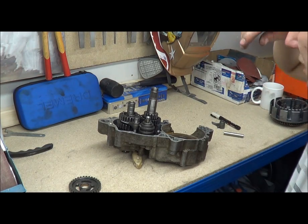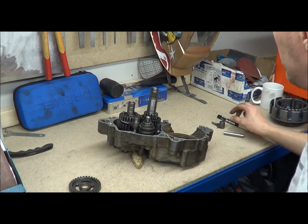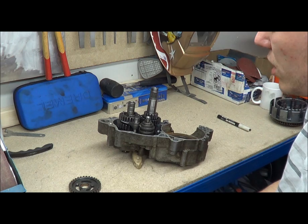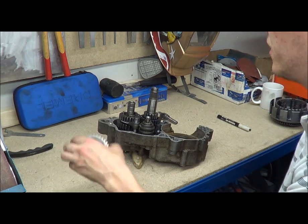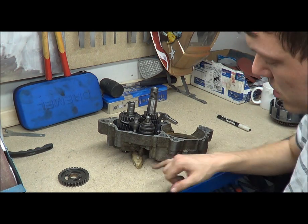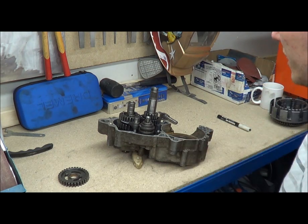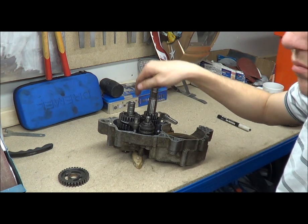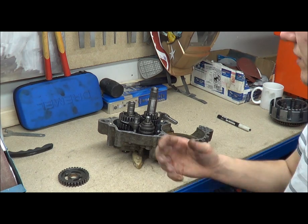Hi, my name's Matt, welcome to Pony Power. We're now going into the second part of the gearbox mini series, and we're going to look into selector forks and selector drum and how this works in relationship to a gearbox. I've removed this one because it complicates things a bit for this demonstration, and I've also removed this gear just so you can see what's happening. I've had to prop it just off the bench with this wire brush handle so that the output shaft isn't touching and trying to turn the engine around. I'll bring you a little closer and show you the basics of the actual movement in the gearbox, and then we'll pull out the selector drum and show you some of the design aspects of it.